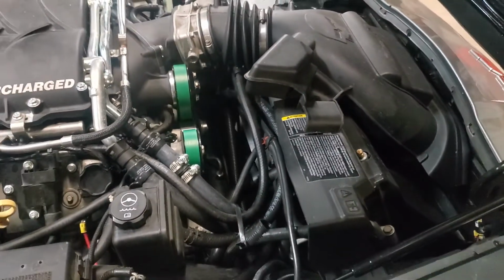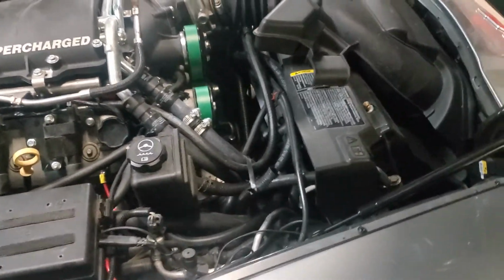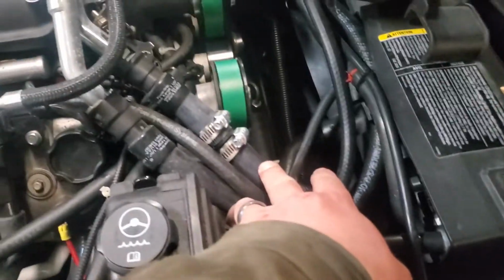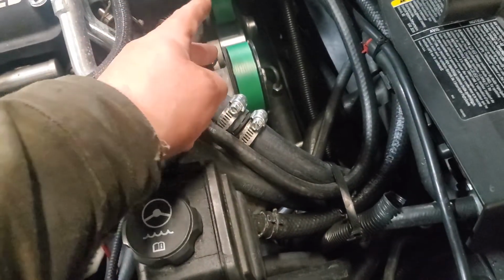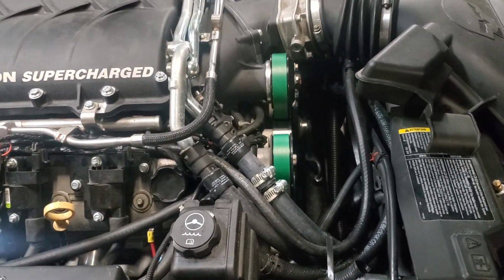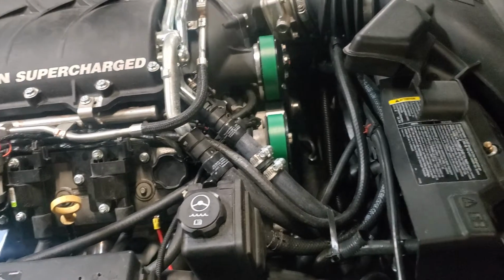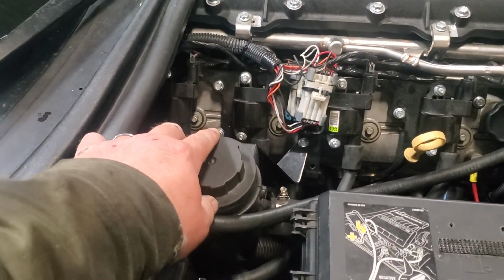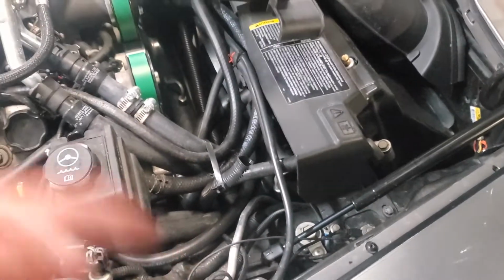It came with an intercooler, or the heat exchanger, I should say, that mounts in front of the radiator, and it fits perfectly in there without modifying anything but drilling like a 1-inch hole in the plastic to get the cooling lines that come up here. This happened on the dyno. This was one piece while we were dynoing it. When he was in the throttle, the tensioner stretched the belt, and that pulley actually touched and cut the line. So I have them zip tied back a little bit farther now so that they clear, and I had to put that splice there. I intend to fix that hose, but for now it's fine. It's not like it's got high pressure. That just has its own reservoir right here with its own coolant, and the reservoir goes to a pump that's down in the front under the headlight, and it just keeps recirculating it.